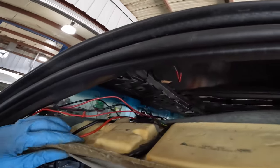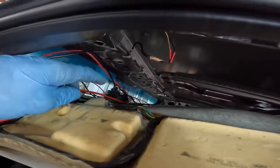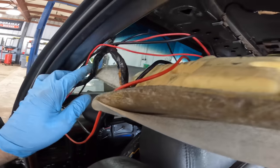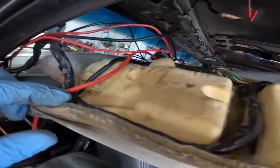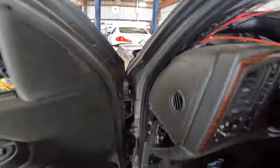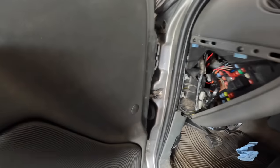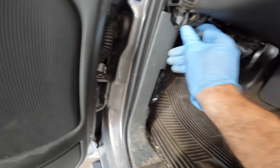It's not much. Oh, we have a wiring harness here. Look. There's a harness built into that unit, and that seems to be running down. Yeah, it's glued on, so we have to detach it somewhere. Down here, maybe? It goes behind the dash. I think it's this connector. Probably runs down to the body control module. I didn't realize that. Okay.